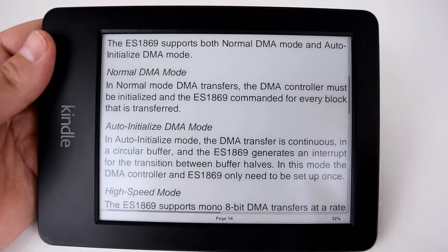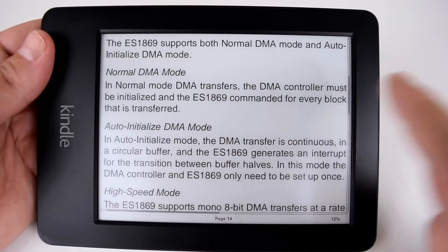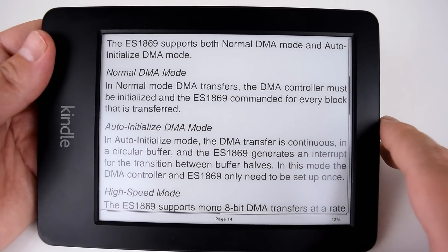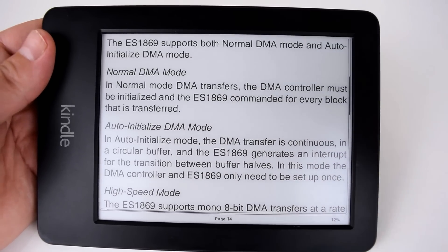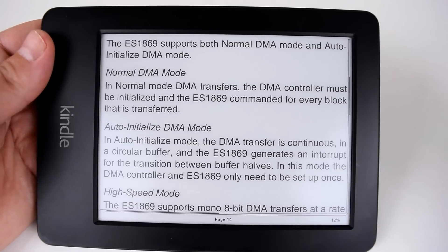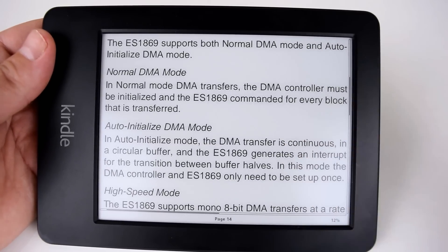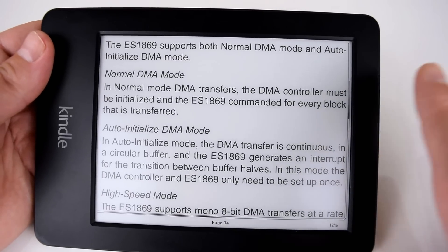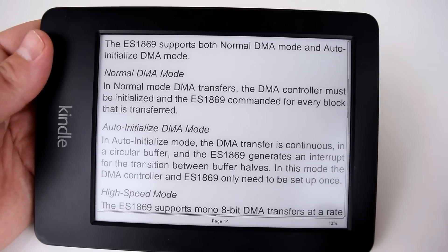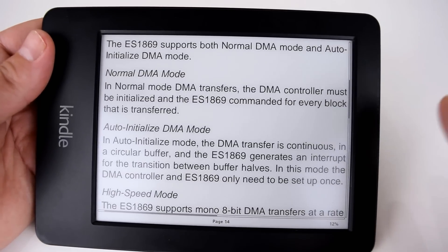This sound card is also good for older games that have issues with single-cycle DMA or normal DMA mode. The Sound Blaster 16 cards, for example, have issues and you will hear clicks and pops in games such as Wolfenstein 3D, or you'll get the tentacle effect if you listen to the digital speech. So this one is free of those clicks — everything sounds crisp and clear.